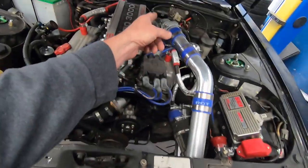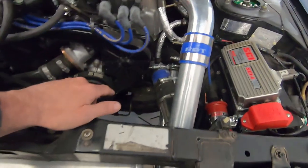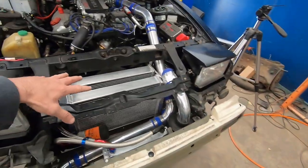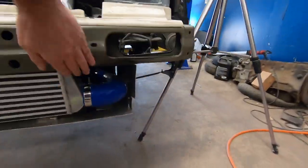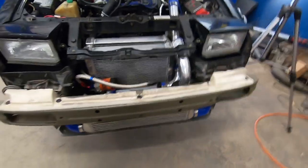This is how I have the routing for the intercooler: from the intake, coming through the side — that's why I had to go with smaller radiators, I didn't want to cut up the fender wells. From the turbo it goes through the bottom into the intercooler, back around up through the side, up to the throttle body, with my blow off valve right here. I had to run this radiator setup in order to route the intercooler piping the way I did. I wasn't a fan of other builds where they cut the body up. The crash bar right there is where it's been hit — that's what makes it crooked. If you guys have one, let me know.